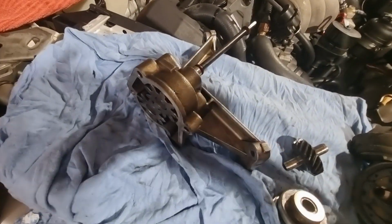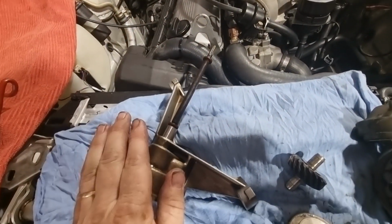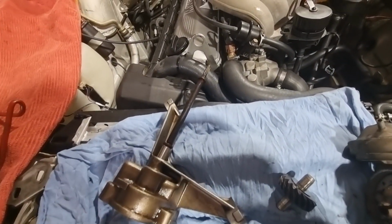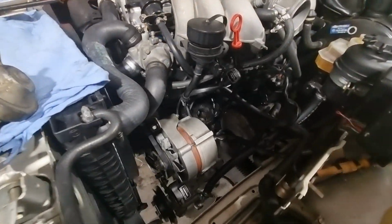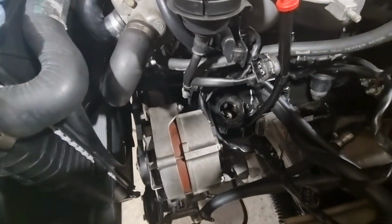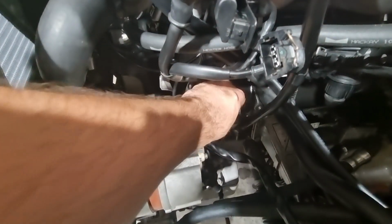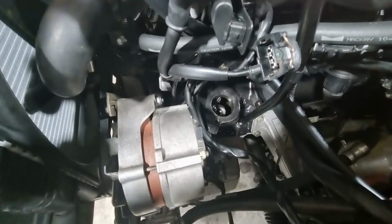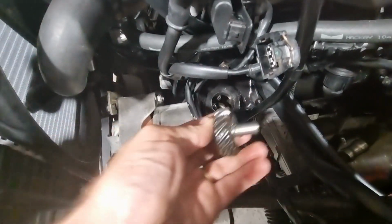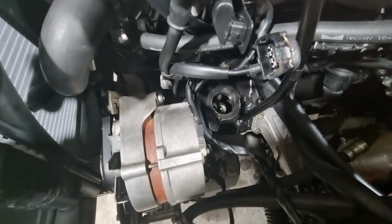Now, what we're going to do with the priming of the oil pressure is we're going to run this drive shaft and prime oil pressure without turning the motor over. Now to achieve that, with the Motronic 1.3 variants, on the side of the block you'll see a round sort of aluminium disc or a cap. We have a plate on the top of it. Unbolt that plate and then take this piece out, and then take the oil drive gear out, which I've already done. Now, on Jetronic variants, it'll be a bit different.